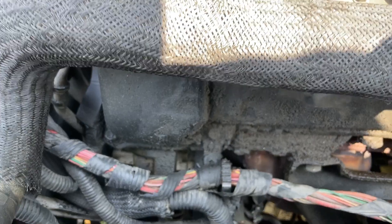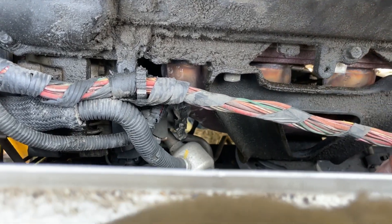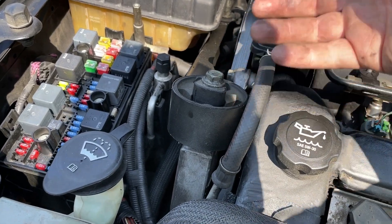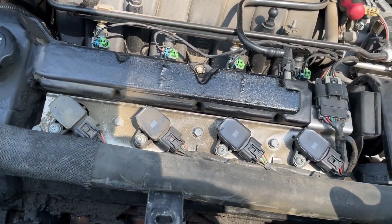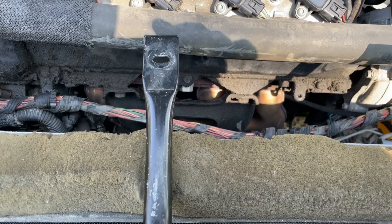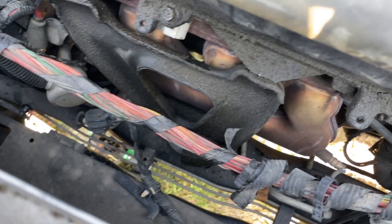You've got the cooling fans right here - we can pull that back - you can probably see it better. That's our mount right there, we got to get that out of the way. These two bolts are going to come out and then that's going to allow this to come forward. Then I'll jack the engine up. We don't have to worry about our dog bone on this car because it's broke - well, we do because we got that nut in the back. We're going to break that nut loose, pull the dog bone off, and take these two bolts out.